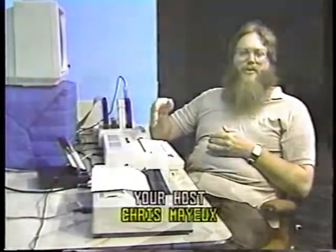Now, before we go, let's take a look at what we've learned and how we can use it. First, we learned how the RS-232 cartridge has 4 addresses in memory, which we can use to turn on the cartridge and send data in and out of the modem. And we can actually change the way the cartridge works to operate at different speeds, or how many different bits we'd like it to use, or whatever. And we saw the print number-2 command, and how we can use it to send a string or a string variable to the printer at any given time. Then we saw the LLIST command, and how it can be used to print all or part of a program's lines to the printer.